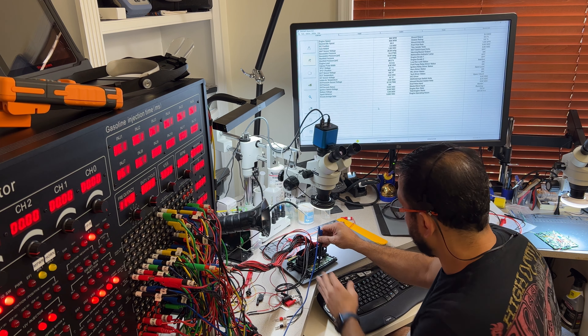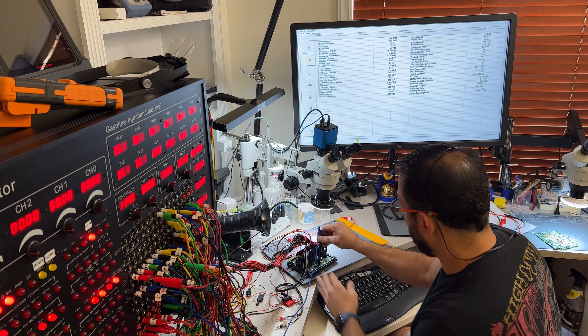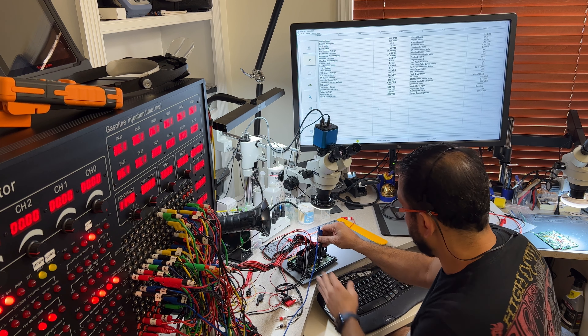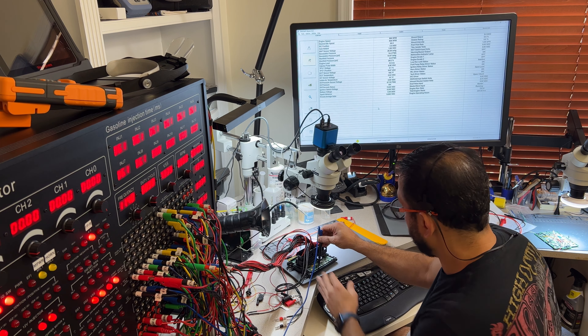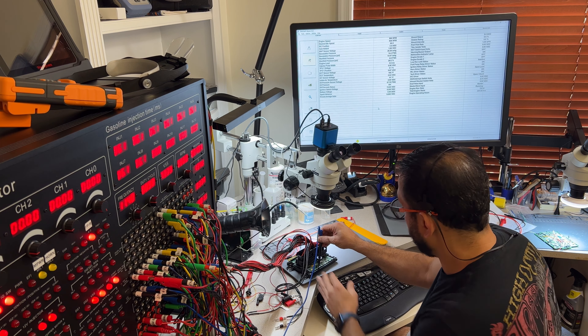Retrieving codes — that's good news. I'm going to try to run the computer, and as you can see the computer is running! The IAC is working, I've got all the injectors. I can change values — the computer is at 990 RPMs. This is a very good sign. It's going to be a hard repair, but it's possible.